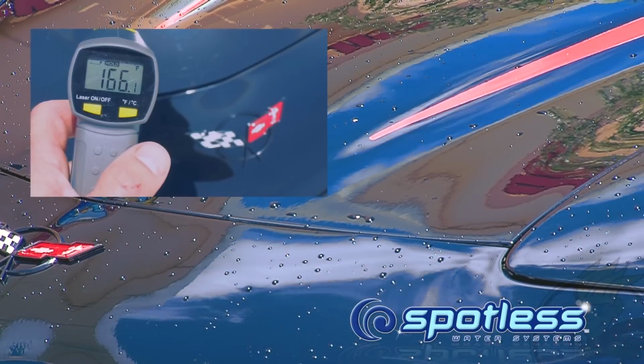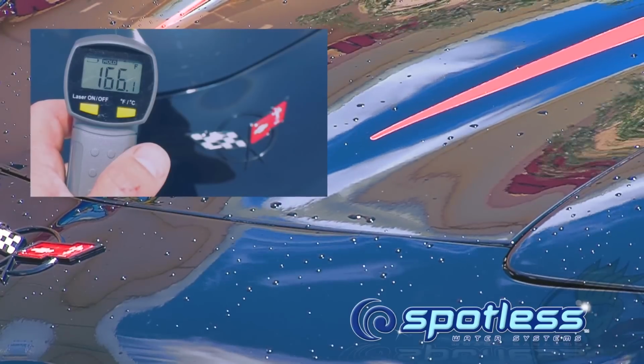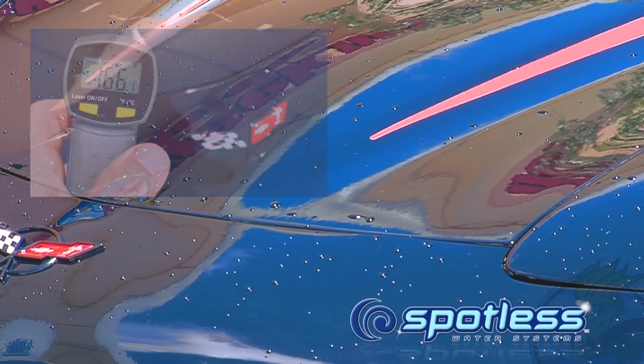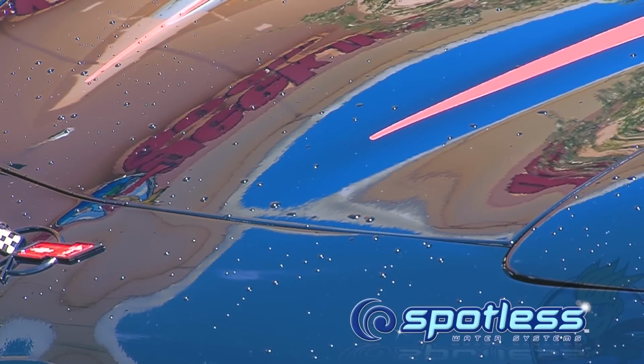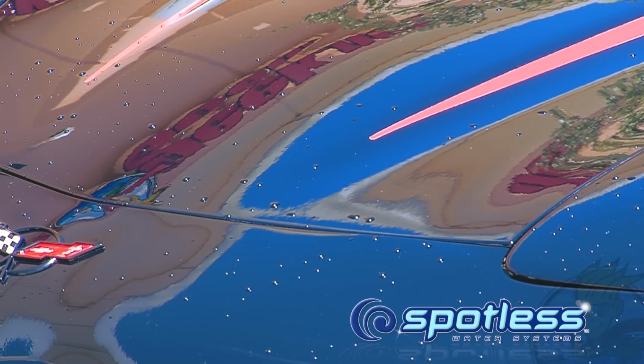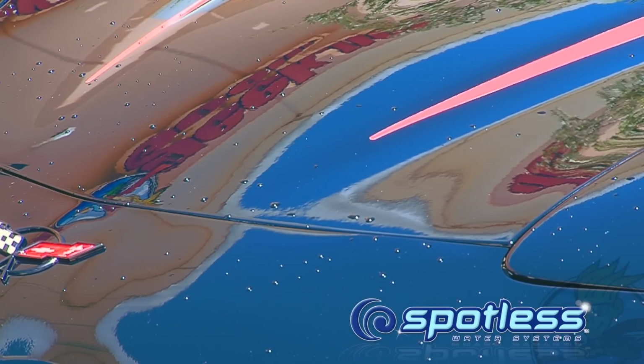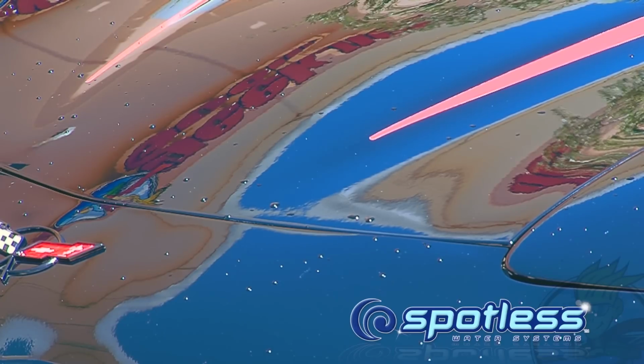If you were outside in this kind of direct sunlight heat, washing your car, and you didn't get the water chamoised off immediately, chances are really good you would have water spots throughout the entire finish. In some cases, this would leave imprint rings, with the mineral deposits left on the paint etching the surface, and these would need to be machine polished in order to remove them completely.